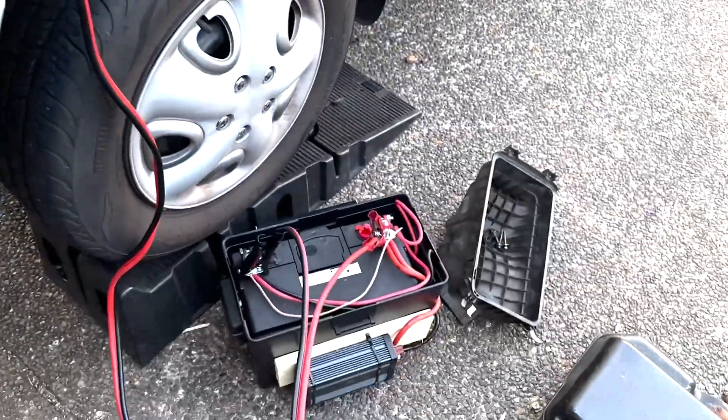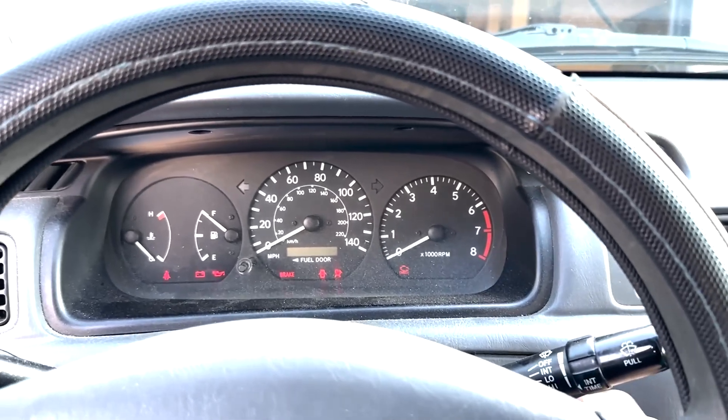So I was filming two different videos — one for the head gasket and one for the timing belt — so I forgot to film a good ending for the timing belt video. At this point you should pretty much be ready to fire up the engine. All you have left to do is hook up the battery and put the valve cover back on. Everything should be plugged back in. Get that battery hooked up, get your valve cover put on along with your new valve cover gasket, snug down those nuts on top of each one of those spark plug tubes — you don't have to get them real tight — and you should be ready to fire this thing up. Got the battery hooked up to my homemade jump box, did a once-over, made sure everything was hooked up, all the sensors and connectors plugged in.